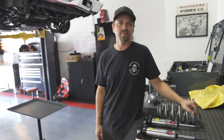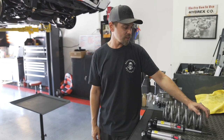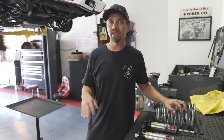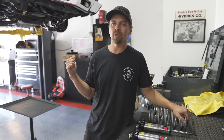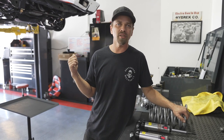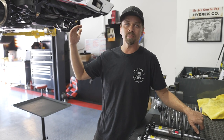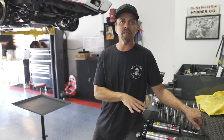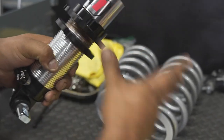Now, this is one of the final adjustments before it goes off. What's next? Correct, yeah, we're doing this to get the ride height up a little bit because it was a little too low in the front. We're going to take it to the dyno next week, and we want to be able to test drive it after that, break in the clutch, things like that. So we wanted to get that ride height up so our tires aren't rubbing anywhere. We got a little bit of time to upgrade this right now. All right. QA1 Precision Products.